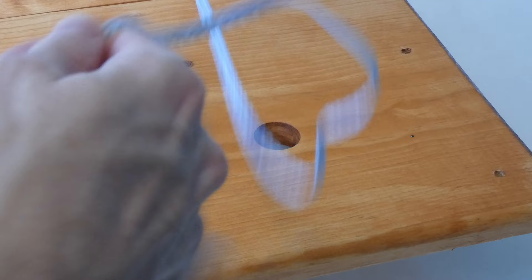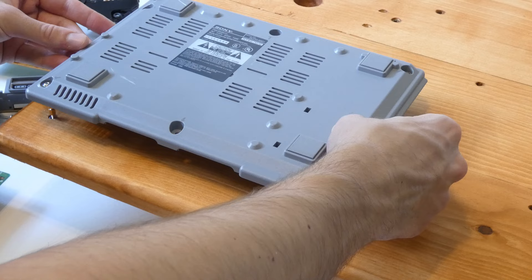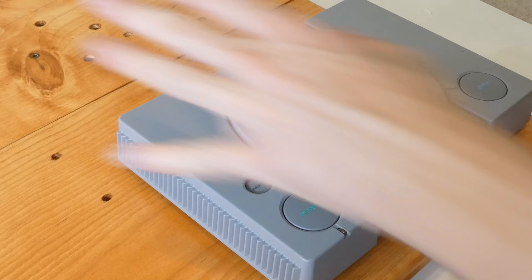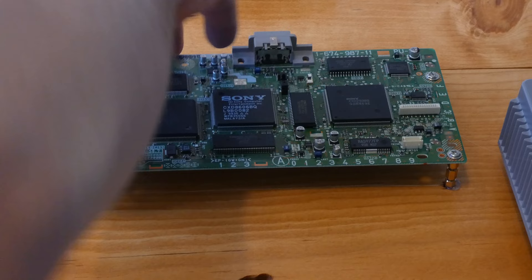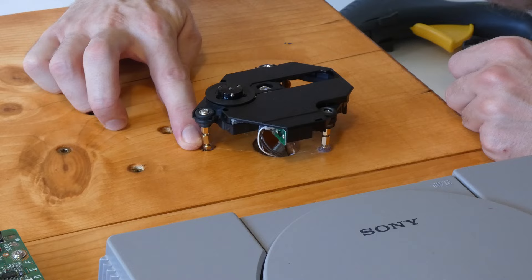It's time to get serious. The first thing I'm going to install is one of these LED light pucks — put a little 3M stick pad and stick it into place. Time to bust out the hot glue gun. I'm going to use high temperature wood glue sticks, fill up all of the little holes, and quickly before it dries shove in all of the components. For the top shell of the PlayStation, I used longer screws in the original screw holes and glued those into place. The hot glue method is working like a charm. Next, glue on the power supply board — perfect. Now for the motherboard — glue up the holes, stick it in, and it's a perfect little table of PlayStation One computing power. For the optical drive I pre-threaded cables through the holes, glued the three little holes, and stuck in the legs. Probably the coolest optical drive I've seen.